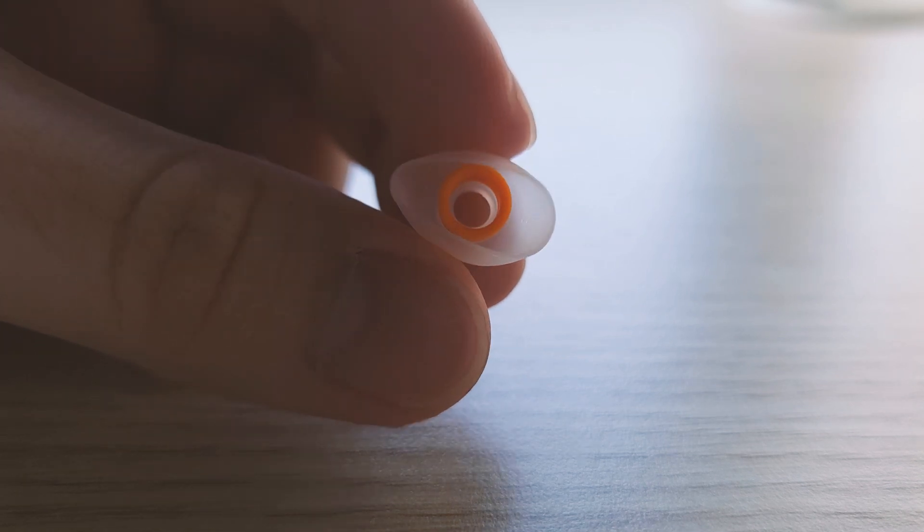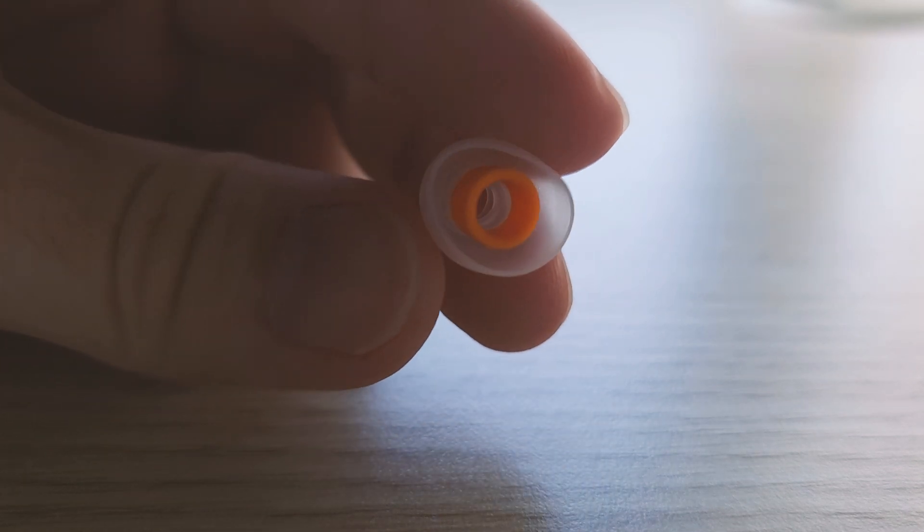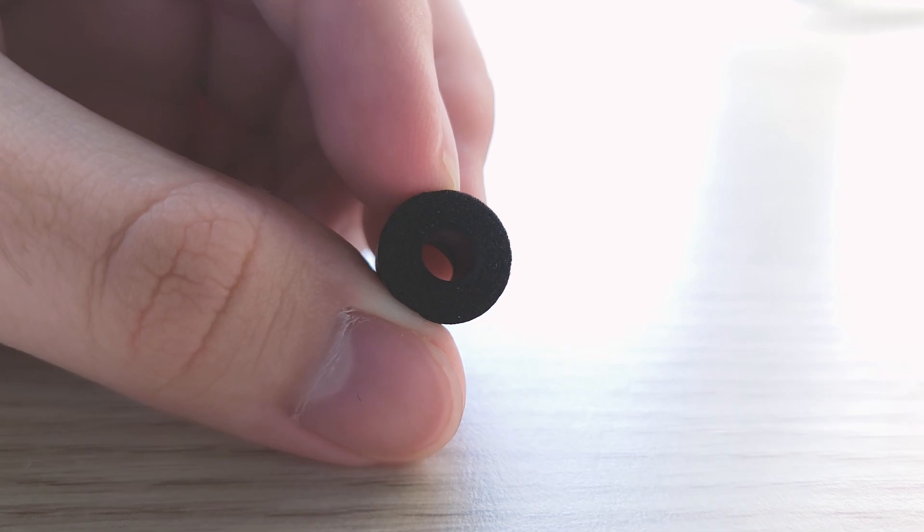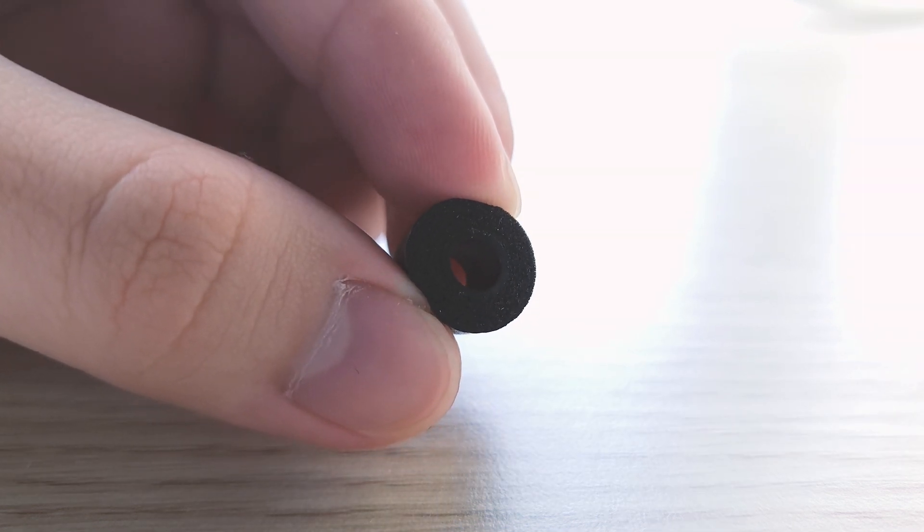Let's start with material thickness. The thicker the silicone on the umbrellas of the eartips, the more bass is emphasized — usually mid-bass, with some sub-bass boost as well. For example, a tip with thin material like spin-fits will usually make an IEM sound more bass-light than one with a thicker material, such as foam tips where the entire umbrella is filled in. Foam also has a tendency to soak up high frequencies, so take note of that, though this depends on the type of foam used.